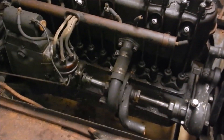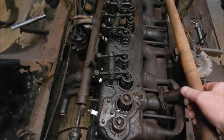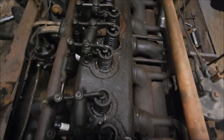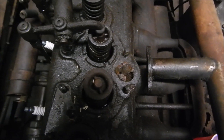As you can see, I put a new hose on there. Usually I use the old hose clamps — those post clamps are 100 years old but they still work. Tearing it down a little after I took this hose out — this is a return hose on the antifreeze. Look at the rust down in that hole, and that one over there too. Mountains of rust in there. I'm going to go after that with a shop vac so that none of it falls back down into the water jacket.